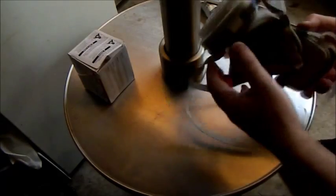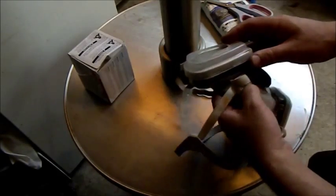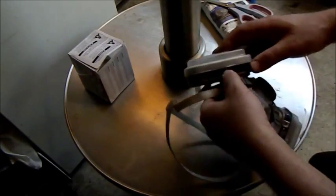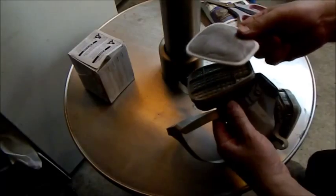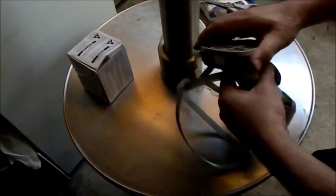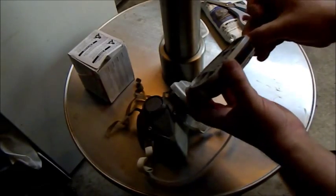This is our painting mask — it's a 3M mask, absolutely brilliant bit of kit. But they do have a shelf life in that the filtration starts to fail after a while. They have a two-stage filter: a particle filter which catches all dust and overspray, and also a removable charcoal filter. I'll pull it apart and we'll have a look inside.